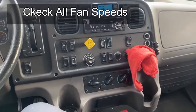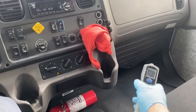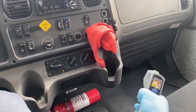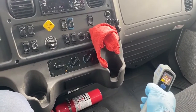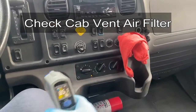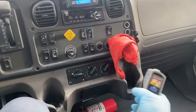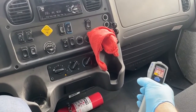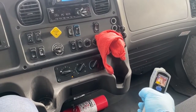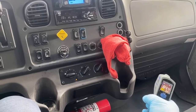The first thing you want to do is come in here and make sure your fans are working and blowing accurately. Sometimes, for instance, these M2s have a filter right down there — you can see where they're pointing that laser. There's a filter right underneath here. On these particular models, they get really dirty really quick and the air volume is really crappy if you don't keep up on these filters. So you've got to have good air flow across your evaporator. I would change those every six months, or check them at least, as those get dirty really quick.